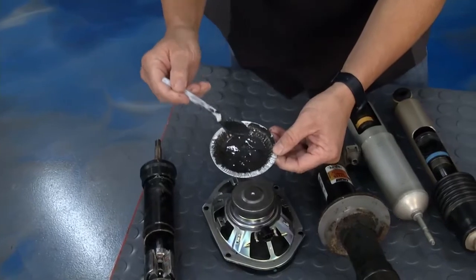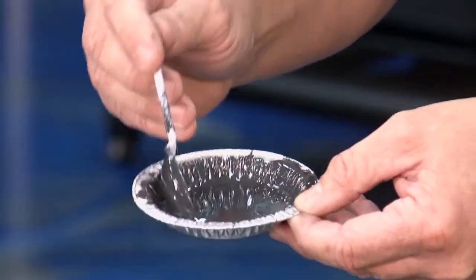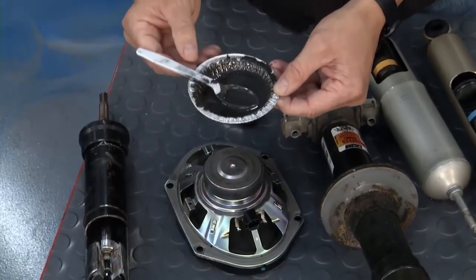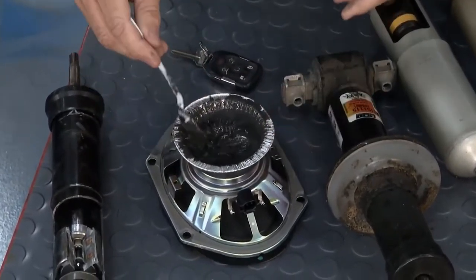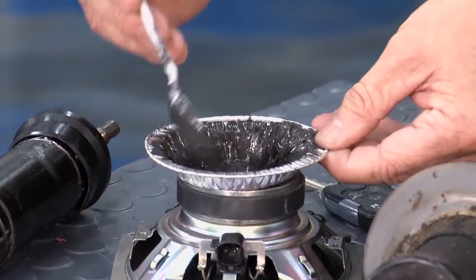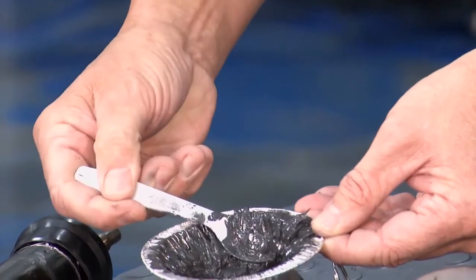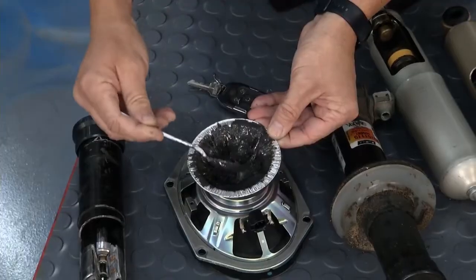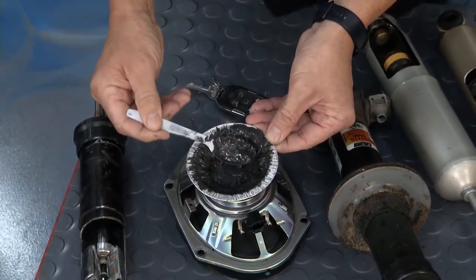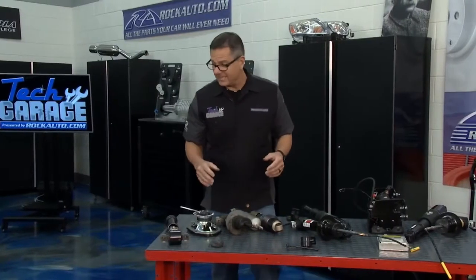This is neat. You can see it right here — this is about the viscosity of it. Right now it would flow through there really easily and it would be very bouncy. Now if we want to stiffen it up, I have a magnet on a speaker right here. I put it down on the magnet — watch this. All of a sudden you get this thick viscosity. That joker will hold up the spoon right there! Now check this out: as soon as you take the fluid off the magnet — voilà — it turns into a thinner fluid. So if it was flowing up in the air like this, you'd get a nice spongy ride. Down here where it's thick, it's going to stiffen up. It does this a thousand times per second, watching that thing bounce.